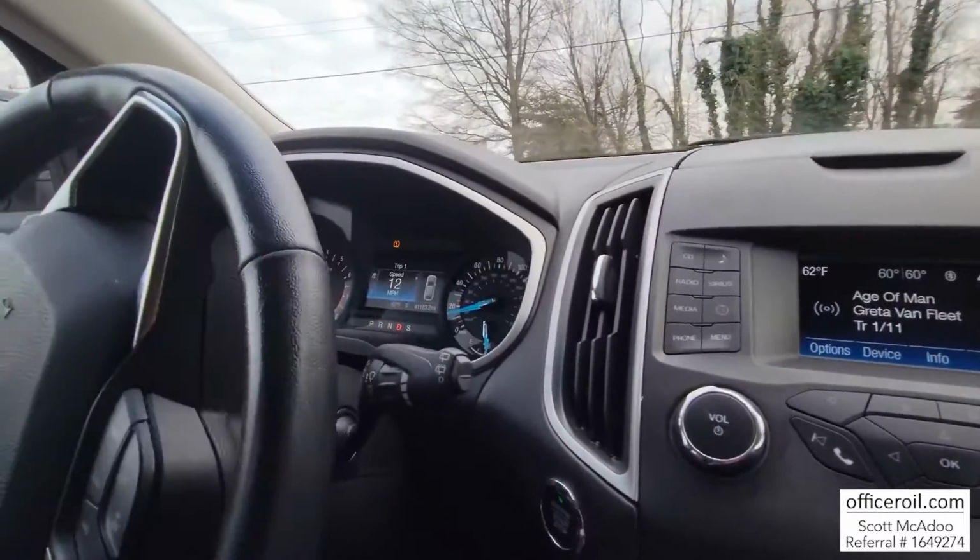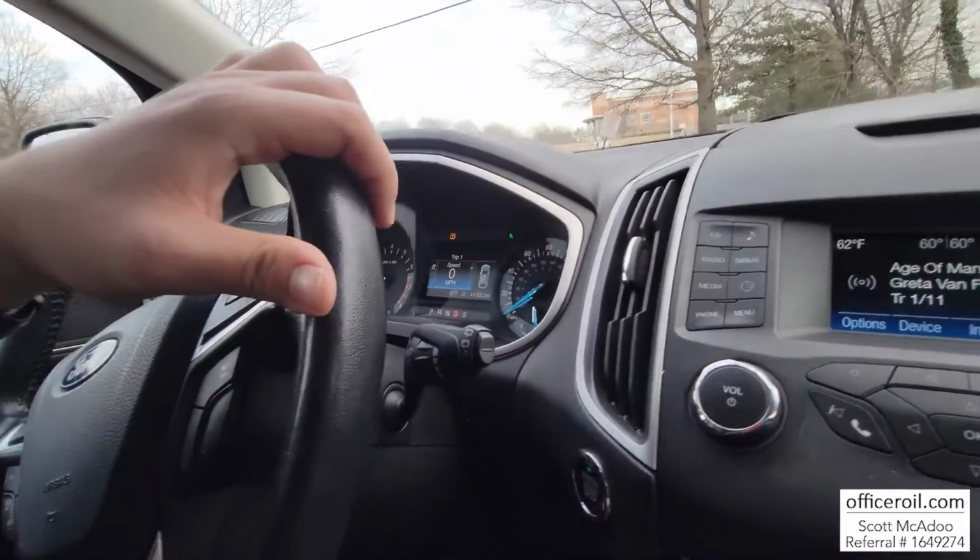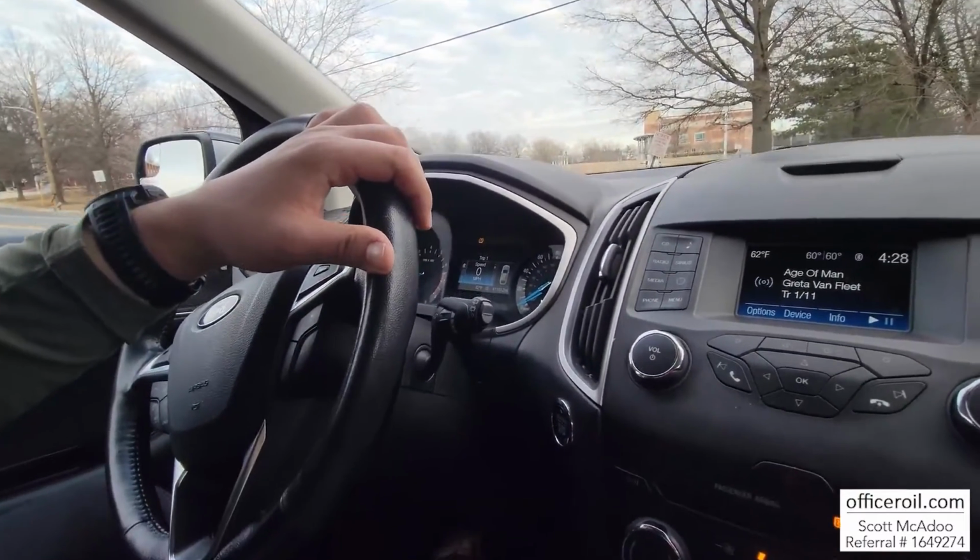One thing I noticed, we've got a low tire pressure warning gauge there, but sometimes the check engine light will pop on with these, which it didn't this time. As soon as you start unhooking things, the computer will recognize that you've changed something. But then you hook it back up, you run through so many cycles of start, stops, and the computer will basically reset itself. This time it didn't even pop, so no biggie. And this whole time, the fuel treatment, the upper cylinder lubricant additive, the PI performance improver is in there cleaning out the entire fuel system and combustion system. That's why we did that first.